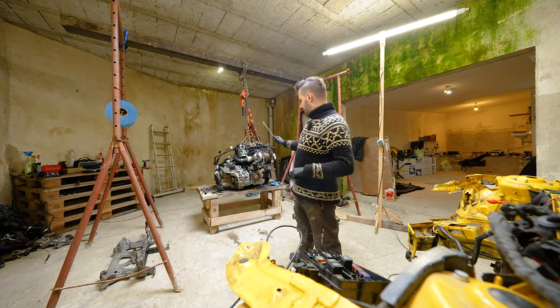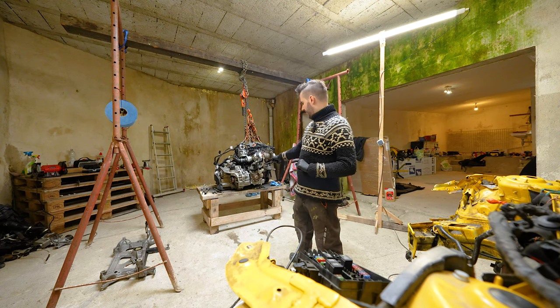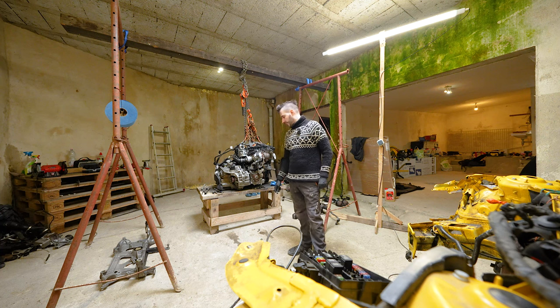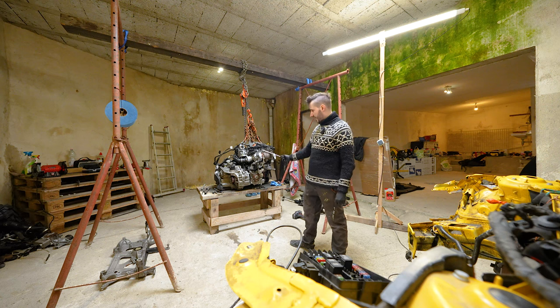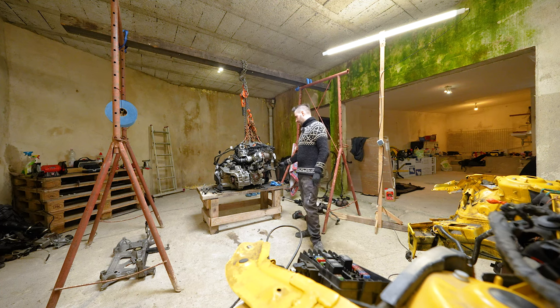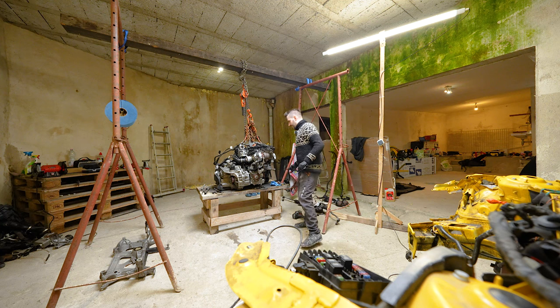Almost all the way down to stripping the front differential off, when I realized I've removed all of the bolts for the last one. I had to lift the engine up so I can reach the fourth screw. There is a bracket that is attached to the engine block, so there's two additional screws which I didn't find on the new secondhand unit that I bought. Then I went ahead and peeked through this hole.